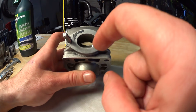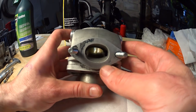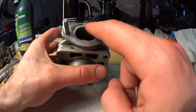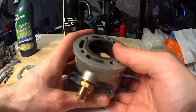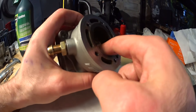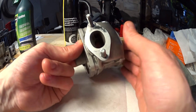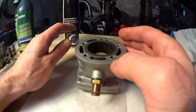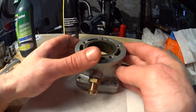When porting your exhaust, do not be tempted to hog out the whole duct to make it as large as possible to match your giant high-performance exhaust system. Do some calculations and try to aim for an exit area of the duct at the flange of about 75% of your large triple port or dual port. You want to keep the velocity high during the blow down phase — the port being effectively smaller during that phase is the key. A wide exhaust port with low duration will give you the same power or even more than a high exhaust port with the same area but higher duration, and the high exhaust port gives you a much smaller RPM range where your pipe is in resonance.